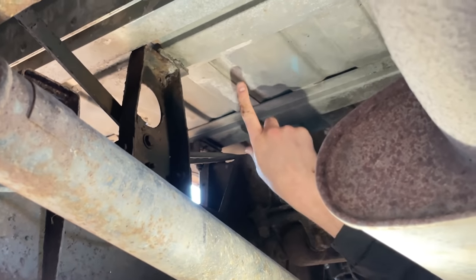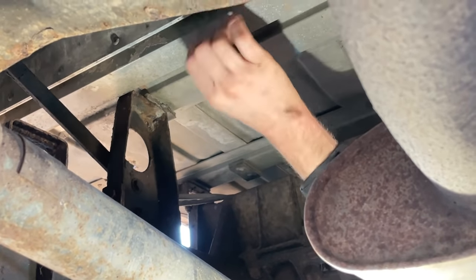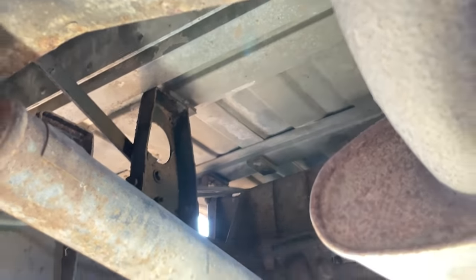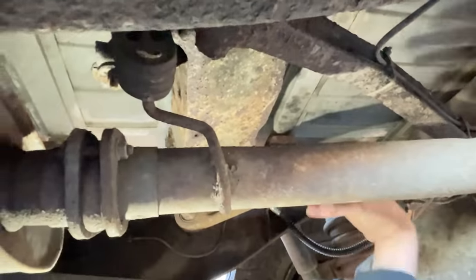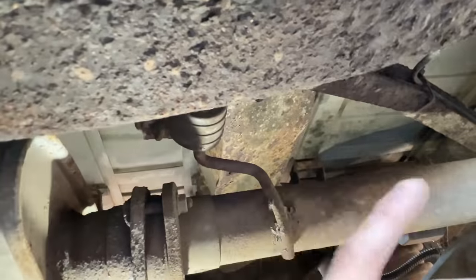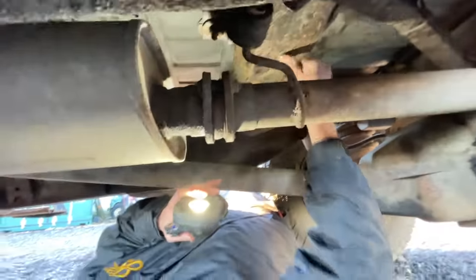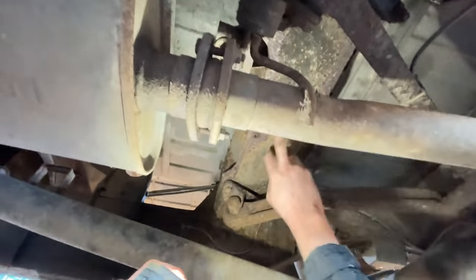The floor panel is looking nice and dry - no scabs or holes or anything in the body. It actually looks watertight, and if someone asked how old this vehicle was underneath, I'd say under 20 years. This is a real hot spot for rust and a pain to weld, because ideally you want access from the top to do a proper job. Make sure the bolts aren't totally rotten, there's no mud sitting on top, and no holes. This one looks pretty good, although it is showing signs of rusting, but that's absolutely fine.